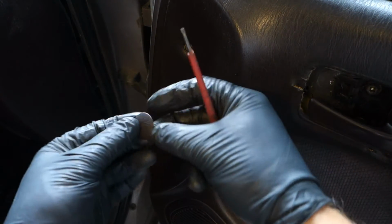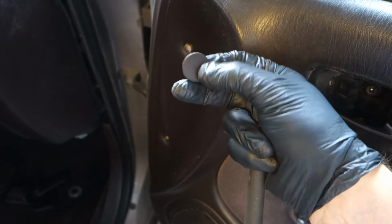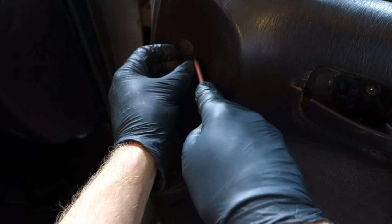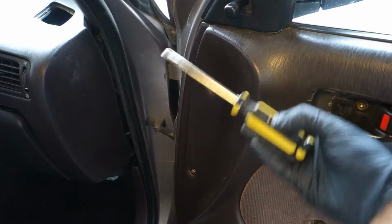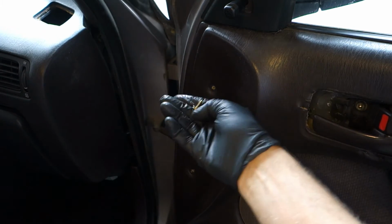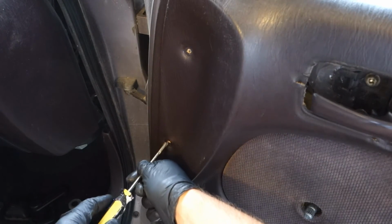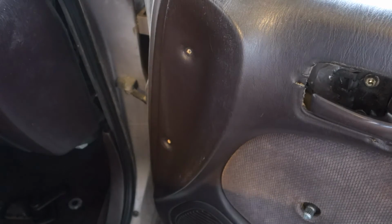And if we lost that cover, no worry, we can go to visit in today or tomorrow in Toyota dealership center, and these covers cost about $1 or €1 a piece, and Toyota will service technician and this spare parts man gives to us new these plates, and they go in here that way, and then when I take that away it opens. Okay, and then there is this Phillips head screw what I need to open, and again Phillips head screw, and I open this screw in that way, and there is specific Toyota's screw, and if we need new one, you know where we can get this new. And now I take this over. There is two screws, and now these screws are open.